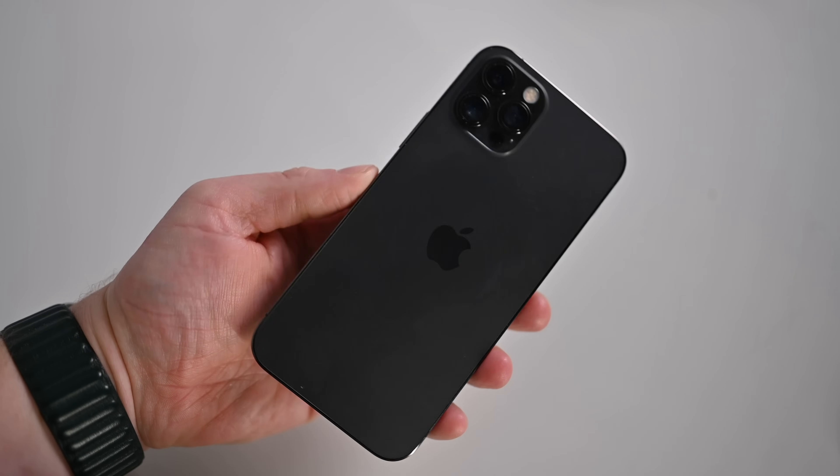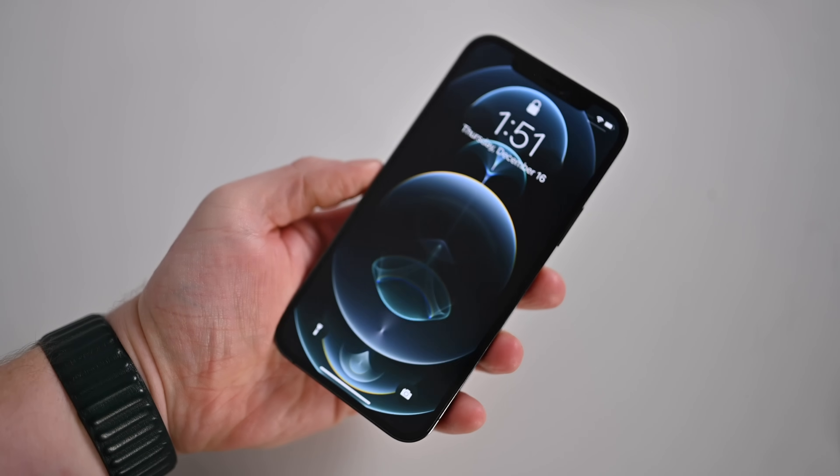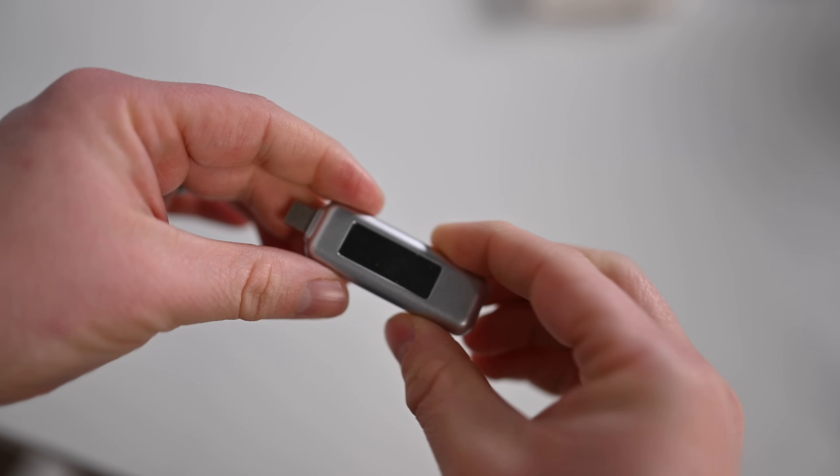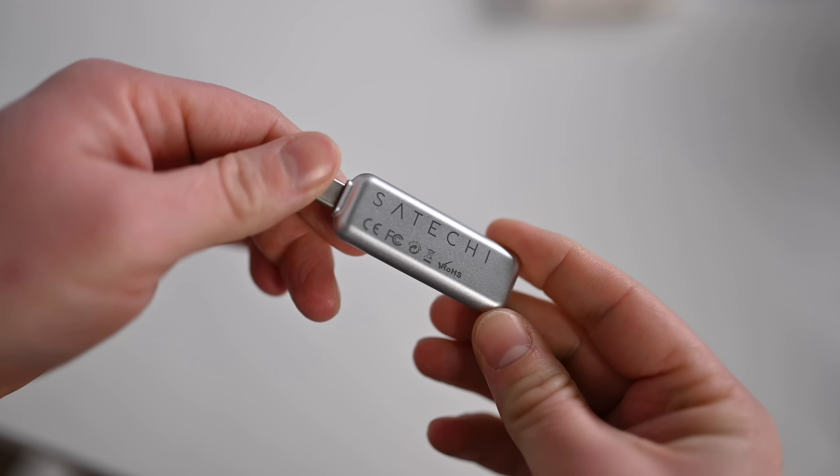Using each of these charging methods, I connected an iPhone 12 Pro — one of the most common iPhones and what MagSafe originally launched with. I used the same phone each time, running the battery all the way down to zero where the phone wouldn't even turn on, then connected it to each charger and logged the charging percentage every five minutes until fully charged. I then went back and used the Satechi USB-C power adapter to measure how much power was actually being drawn while charging via MagSafe.